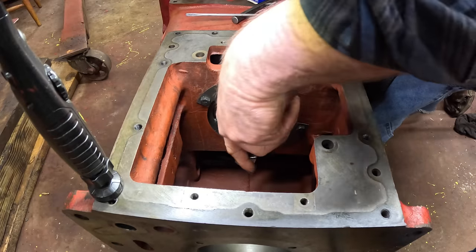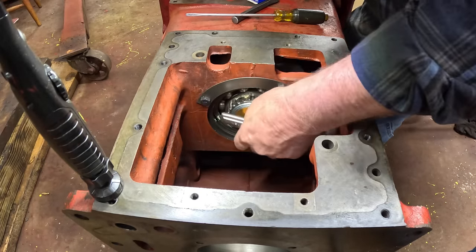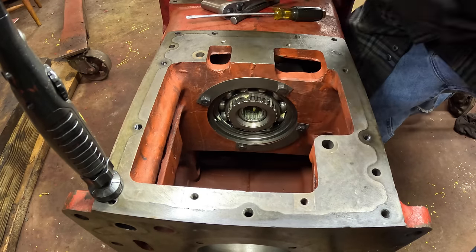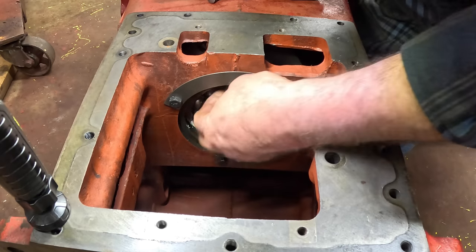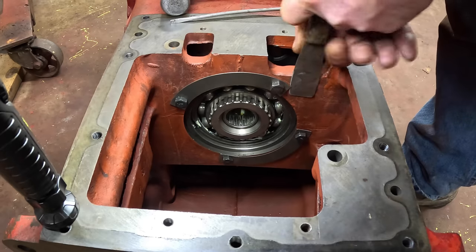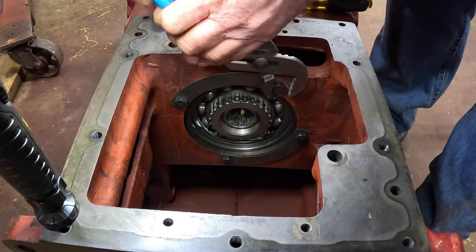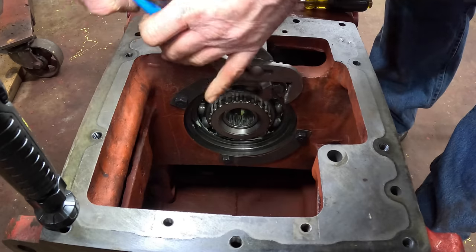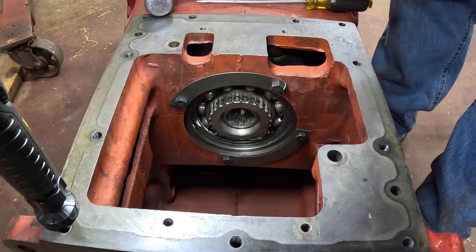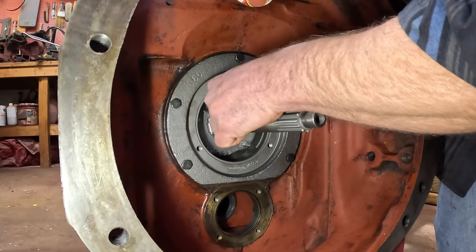With the case turned back horizontal, hook in the rear bolts of the quill cage that go through this baffle. I put some blue Loctite on these as well, even though they've got lock plates - belt and suspenders. Now our holder can come off for good. It's got good rotation. With the torque amplifier all secured, we can take this hose clamp off of the front.